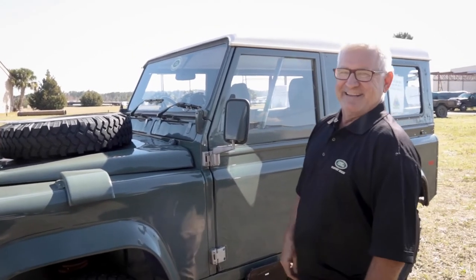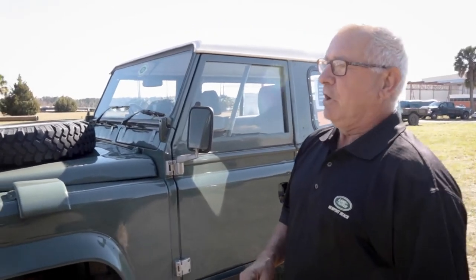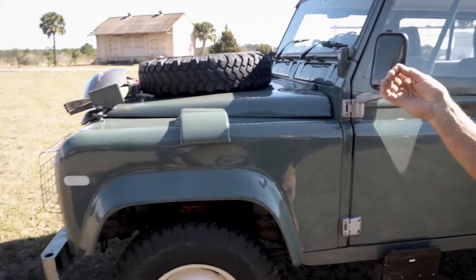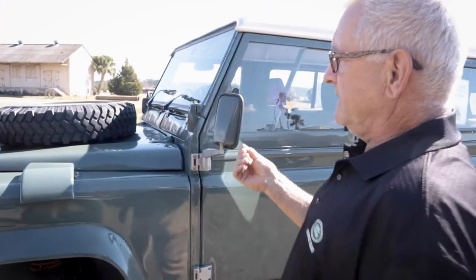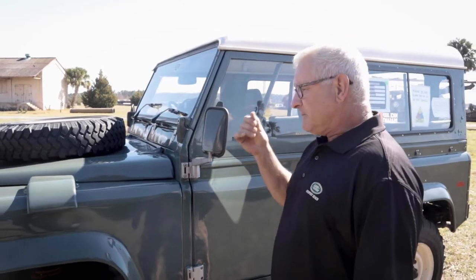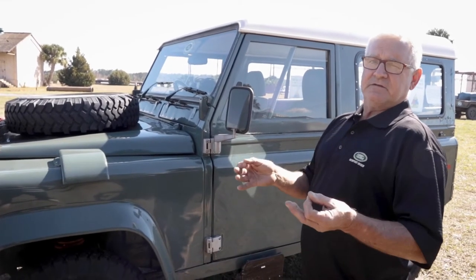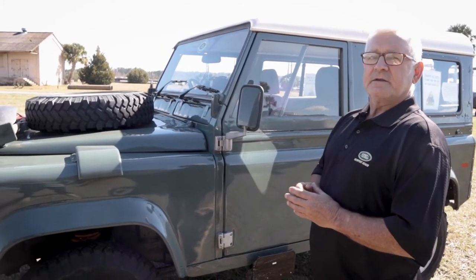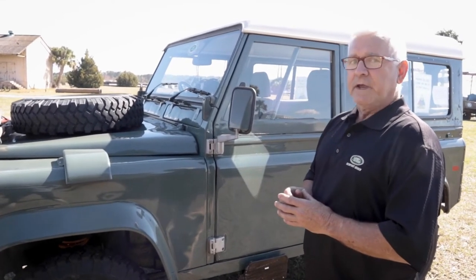It's entered in the show, but I really don't care if I win. You already won with this one! So tell me - did you get it just like this? No, this was a ground-up restoration. It was actually purchased in upstate Vermont - one of four vehicles on the property just rusting. We threw it on a trailer, brought it home last April, tore everything down right to the frame. Every nut and bolt that could come off came off, got replaced, fixed, or refurbished. Complete frame-down restoration - put it on a rotisserie and everything.